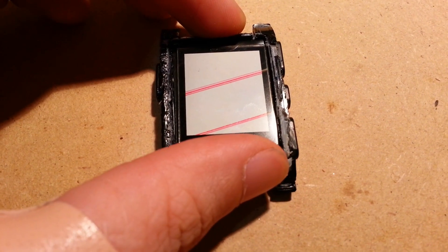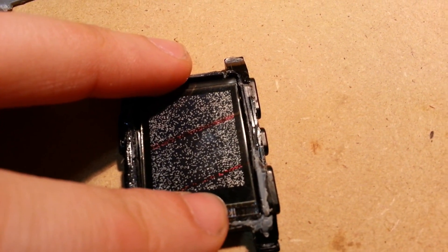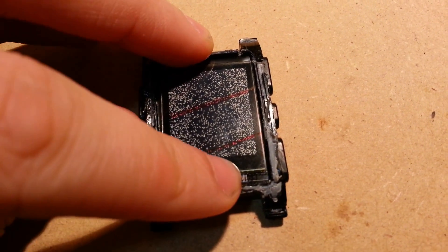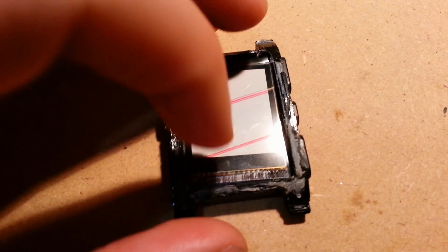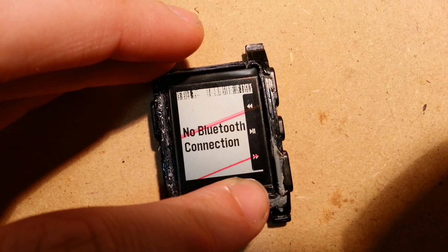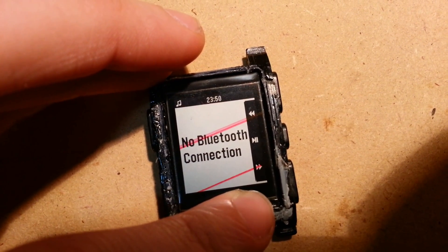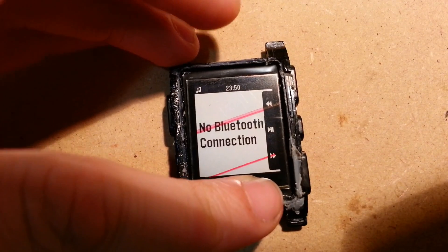Once you get the pressure on it like so, the screen comes on. The Pebble hasn't written to the screen yet because since this is an e-paper style screen, it's just going to have garbage signal in it. You actually need to press a button to realize that it works. That's just some garbage data — press the button, there you go, and then it refreshes. The screen works just by pressure and as you can see I'm just kind of wiggling on the contact — it's pretty robust.